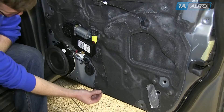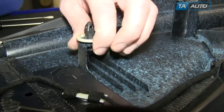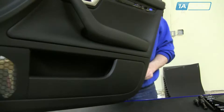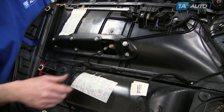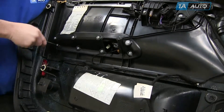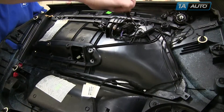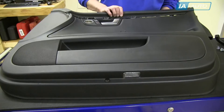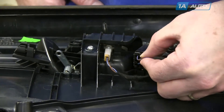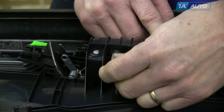You might need to use a hammer to tap the clip back into the door. You might also want to glue in any clips that fell out during the panel removal. On the back of the door panel, unplug your power window switch — there's just a little tab that you press and pull out. And then nine T20 Torx screws hold the armrest in place. Now you can remove that armrest. Turn the door panel back over, disconnect the door lock switch by pushing down on that little tab and pulling. And then the LED light — just twist it slightly and pull out.